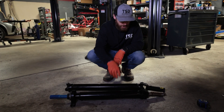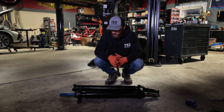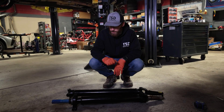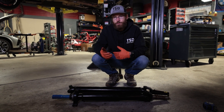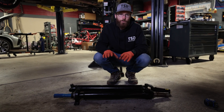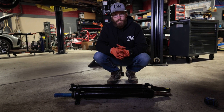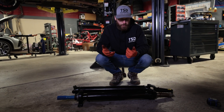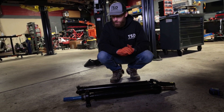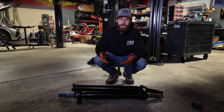We're upgrading to this two-piece driveshaft from Performance Driveline — the same company that manufactured the single-piece driveshaft in my truck, which has been holding up very well. The difference with this is it allows the truck to be lowered while still having clearance. People also upgrade their driveshafts because Chevys are known for a shaking issue, believed to be due to the very long thin-walled driveshaft having resonance frequencies at certain RPMs or not being balanced perfectly.